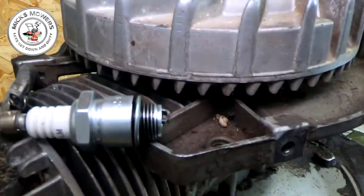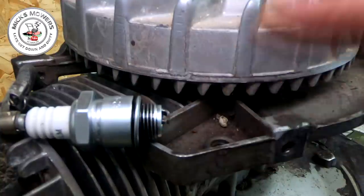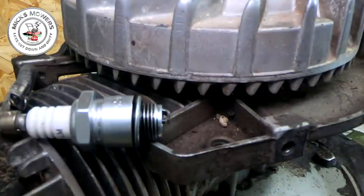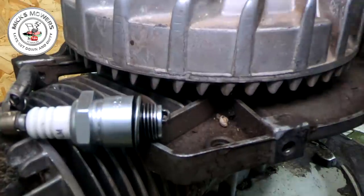I don't want to wind it over too much because it is a two-stroke machine and there's not a lot of oil in that bore - I did put some in but obviously it starts to come out. So anyway, we have spark - we have spark, that's confirmed. New set of points, new condenser - fixed that. The carburetor has got to be done because the carburetor around here is absolutely disgusting - I dread to even think what's in there. If it's dirty outside, it'd be dirty inside. What we'll do now is put the cowling back on, and then we'll go outside and have a little fire up to confirm it's got a combustion chamber that actually works. If it don't, I think that's where the road will end for this little machine, but if we get it just to pop, then we will carry on.